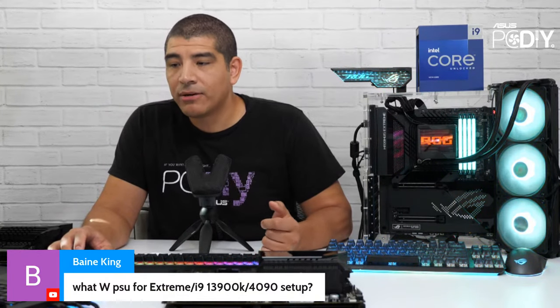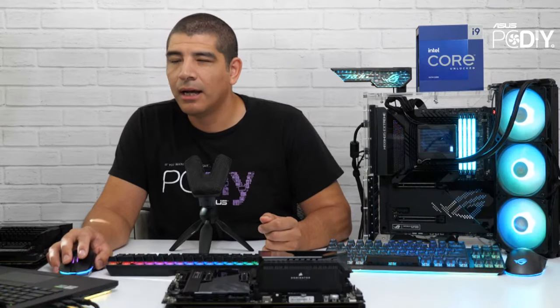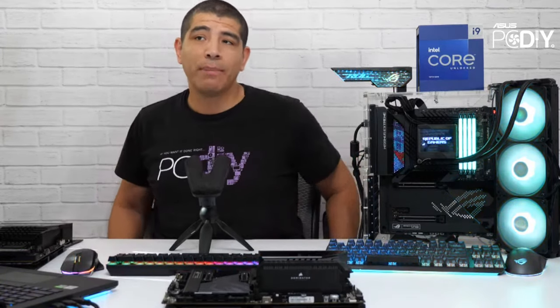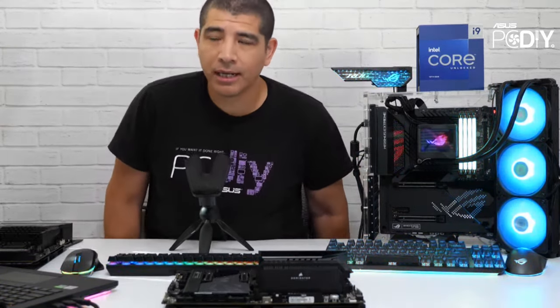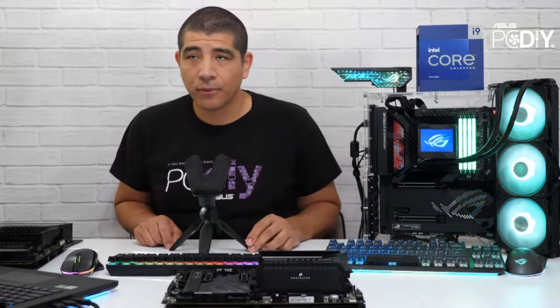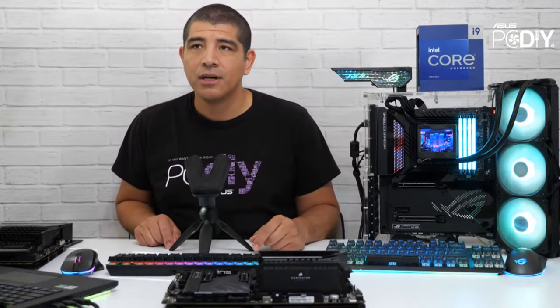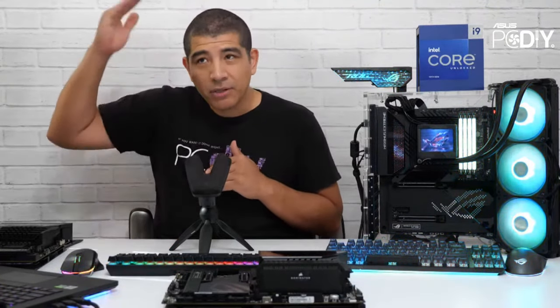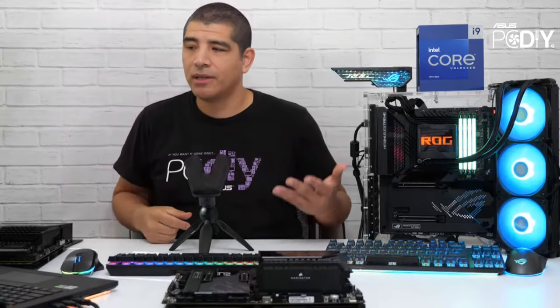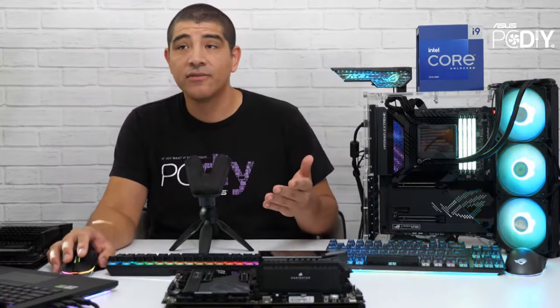Bain is asking, what power supply would you recommend for a 13900K and a 4090? My recommendation would probably be a 1,000-watt power supply. 1,000-watt would be a good option. Keep in mind that you don't have to worry so much about transient considerations with the 40 series, because the 40 series has better transient performance than the 30 series. So you don't have to worry about the bigger spikes that might have been present with a 3090 or 3090 Ti or something like that. So I would say that's a very good choice.